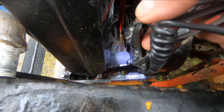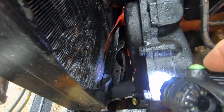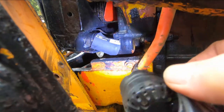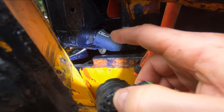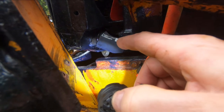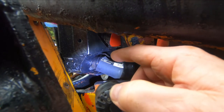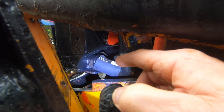I'm just getting it fit on the engine side, then I'm going to see if I can get it around the part on the rad as I sit it down. It's a little bit of a wrestling match. I put it on the engine side first, then by moving the rad as much as I could, I pushed on this new hose and got the other side of that hose over the lip on the spud sticking out of the rad. I'm just about to bring the radiator down a little bit — it's a tight squeeze.